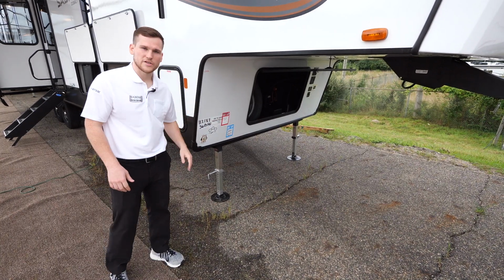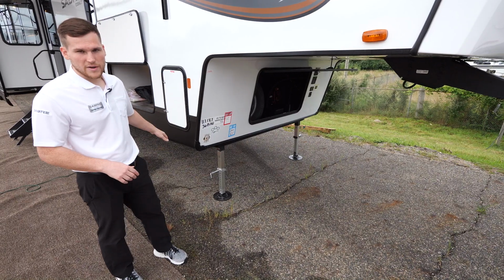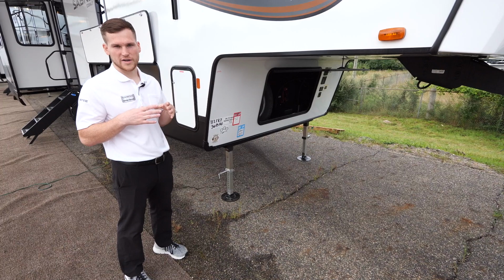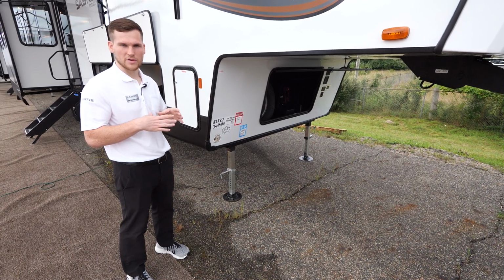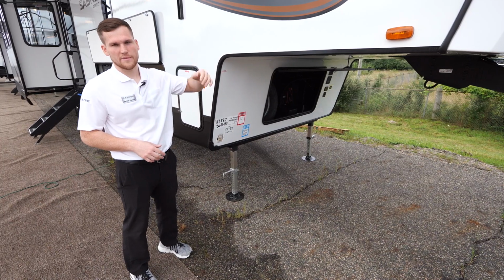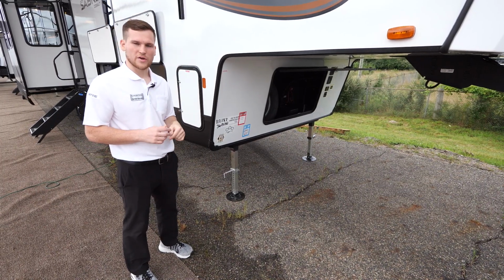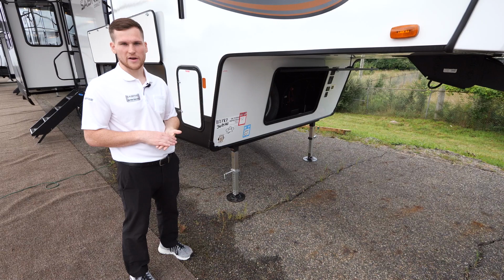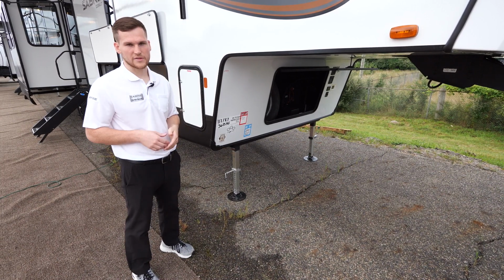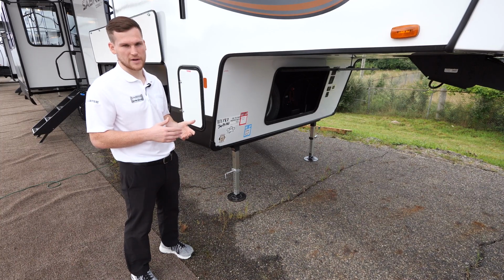Then you have the Polar Shield sticker. That's a very important feature. It's a fully enclosed underbelly that's thermofoil wrapped, fully insulated, and it's also forced air heated. So there's furnace ducts that go over the holding tanks, blows hot air into the underbelly. We also thermofoil wrap the front cap as well as the roof. If you're planning on camping down to about 20 degrees Fahrenheit, -6°C, that's where we would recommend skirting the underbelly, taking extra precautions so you don't freeze your pipelines.